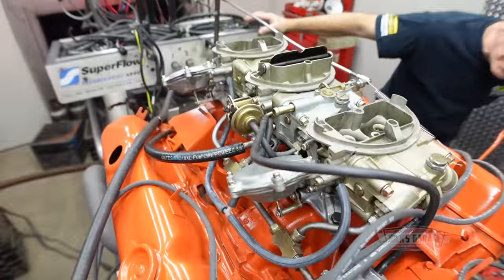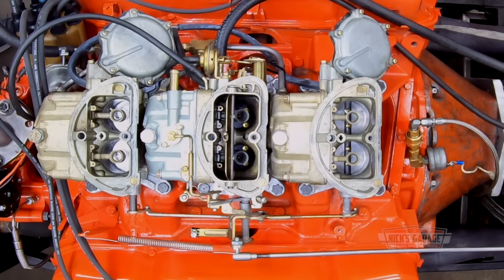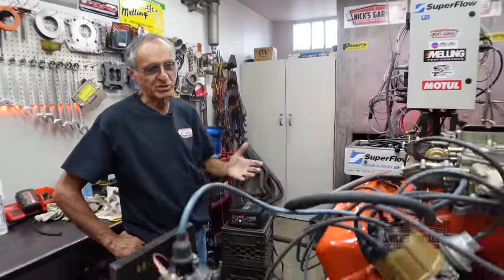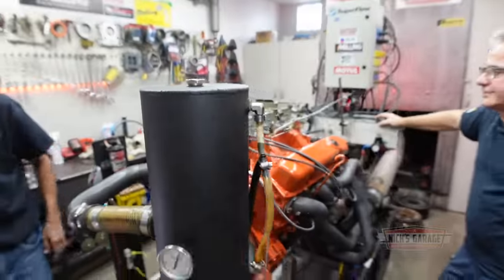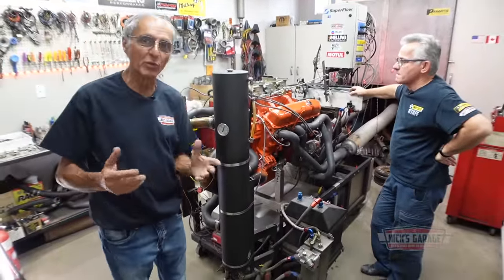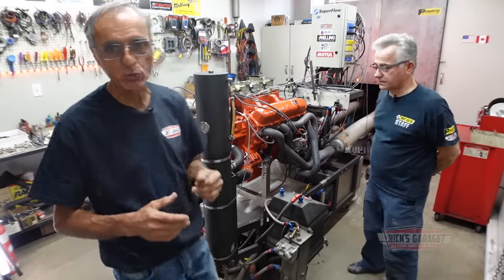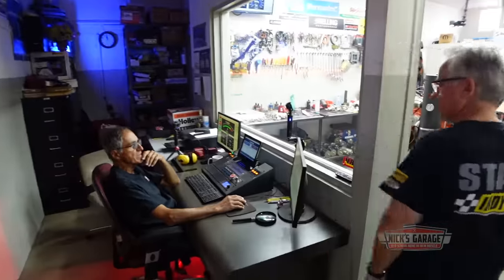And you notice the stumble, when I go slower, there's less of a stumble. So I'm going to do it again. Let's put the air cleaner on after. And I want to see if we get back that 500 foot-pounds of torque. Yeah. I brought the timing back where it was. I want to make sure the air fuel ratio is good on idle. Then again, that's another thing to figure out if we do go to exhaust manifolds. But in the meantime, let's work with what we got. Sounds good. I just want to make a test with the timing back where it is.